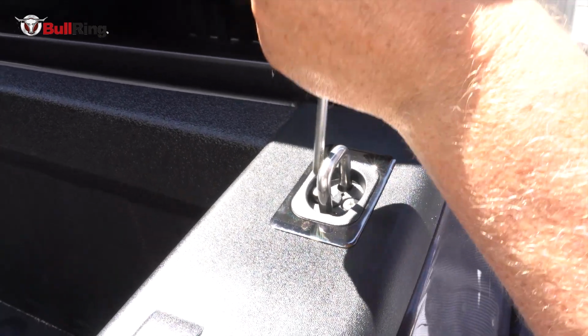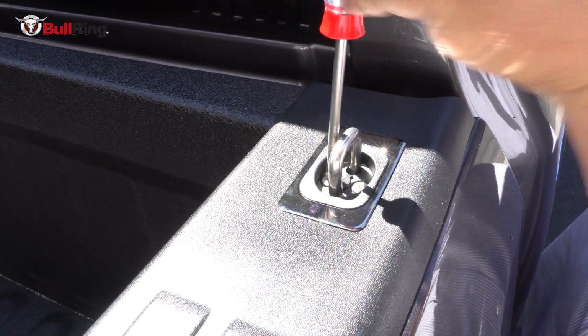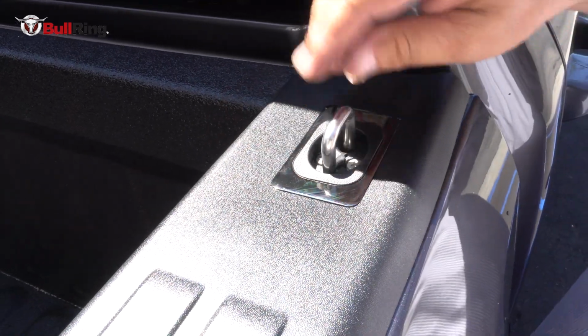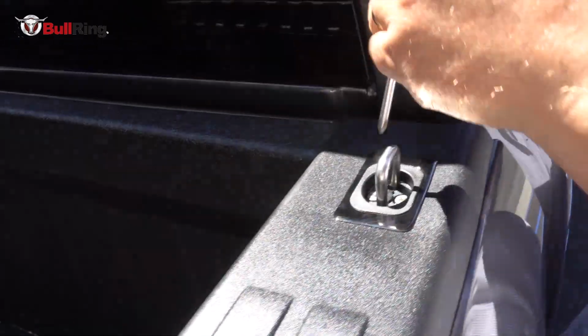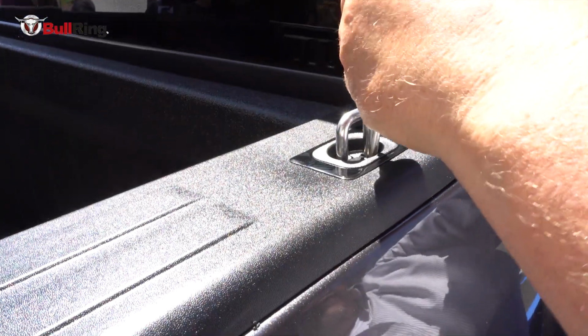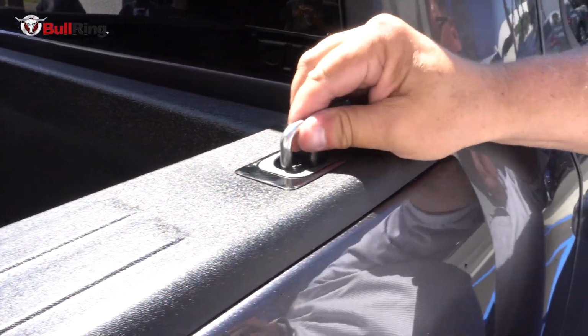It's actually torquing about 10 pounds, which again is about the amount of force that's required to turn off a stubborn garden hose. And that's all you need. The screws are just there to hold it in place. You don't want to over tighten it. In fact, I'm going to back this off a little bit because I've started to distort the rail a little. And you'll see as I turn this back, it comes right back into shape. Beautiful. But it's locked in.